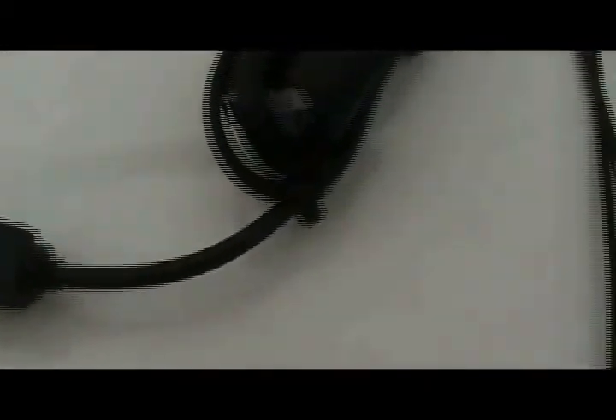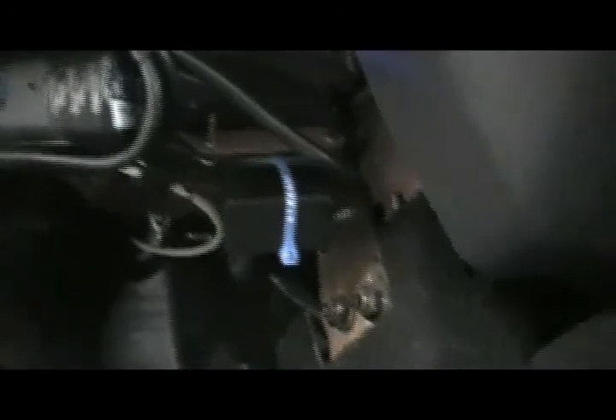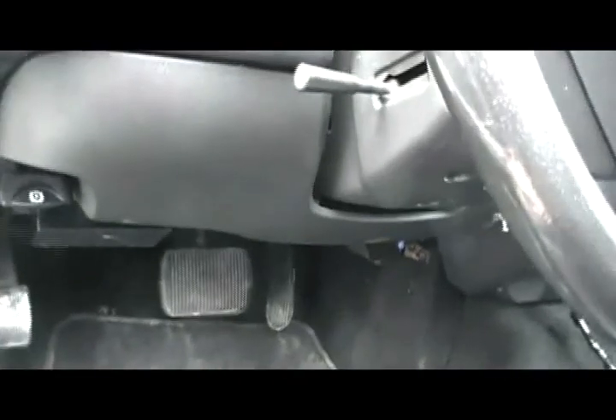I've made one of our famous relocation cables bundled up with the device so that we can fix this up under the dash. From this point on, all we're going to need is some tie wraps and our snips. So our installation of the GO6 device with the cable — if we put the camera up under the dash, there it is. We've got our OBD2 connector with the security seal, we've got our bundle, and from the driver's perspective the device and everything is right out of the way. It won't be in your way for driving.